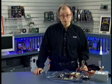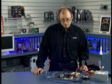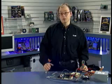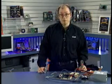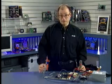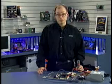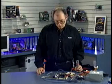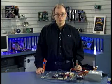At a temperature of over 500 degrees, it's clear to me that this processor has not survived the heat test. If this test does anything, it should give you an appreciation of the importance of installing a heat sink properly and making sure it's properly attached and does not come off. If you power up many modern processors without a heat sink properly installed, you will destroy the processor, as we've done here. I hope our little test educates you on what to do and what not to do with your processor.